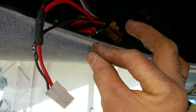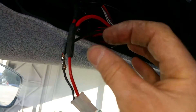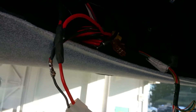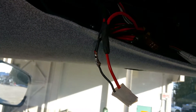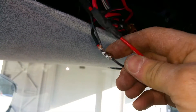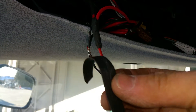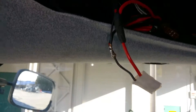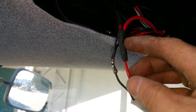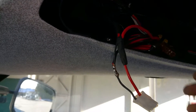I splice the two power wires — I remove the insulation and make a kind of split in the middle, then connect the radio power through that hole. Twist it, use a flux pen prior to soldering so you get a good joint. Then I start with some rubber tape — a soft rubber tape — and on top of that on each power wire, use normal electrical tape.